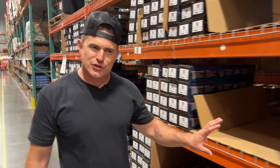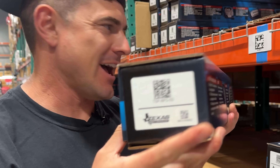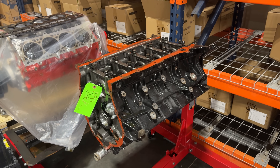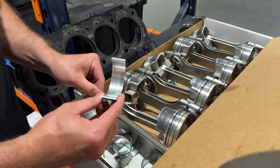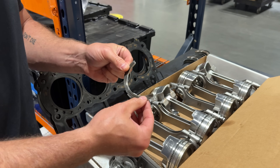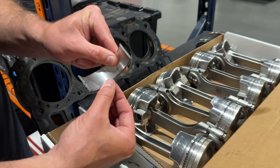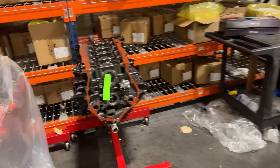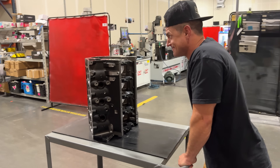The first order of business upon arriving at Texas Speed was to check the stock of my BFD cams — and we got some. After that, we checked the status of my Godzilla, and as it turns out it's pretty messed up. Apparently oil floating around the system doesn't do so hot for the cam bearings — those are pretty galled up. The main bearings are all smoked as well. The boys found chunks of thrust bearing floating around inside the block, and there was uneven wear on the pistons due to the crank walking back and forth. The takeaway: the motor definitely needs a full rebuild, and probably a little more R&D before we throw a lot of power at it. So in the meantime, we're gonna build something very tried, true, trusty, and extra strong.